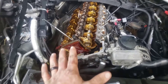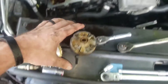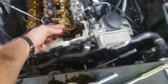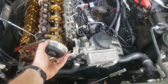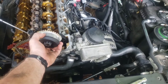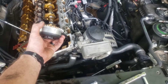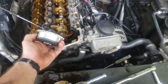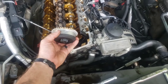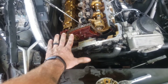First thing you're going to want to do is you're going to see these cam gears. The cams will spin, and in my case what happened is the intake cam bolts sheared off the Vanos — and this is what it looks like all together, this is the new one. These bolt heads sheared off, so the gear was still hooked up to the timing chain but the Vanos assembly was just spinning freely from the gear. So these bolts hold this gear to this Vanos assembly. I'm hoping we didn't bend or break any valves, and the exhaust one was still hooked up and still in time.